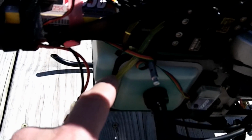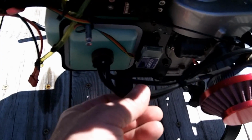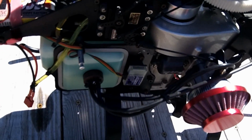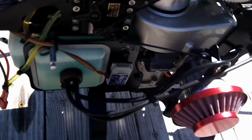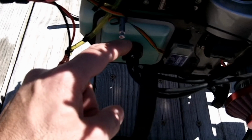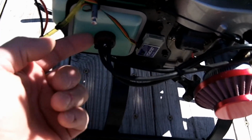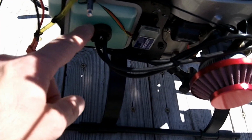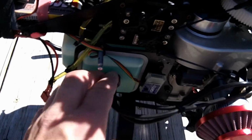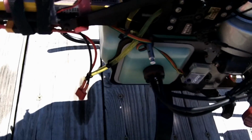Vent and fuel line was replaced. These lines still look good. I had them on order. I just want to say a funny thing. Every time I go on the forum and ask a question, I end up spending money. You guys are killing me. But anyways, I ordered all new lines. When I took the stopper out, I think the clunk line wasn't even on. I was somehow getting fuel because it was above the tube line, and I fixed it, but the rubber in here I had to carve down to fit back in. She's fitting tight, but I'm not worried about it.